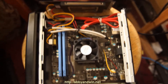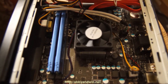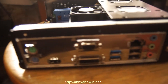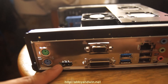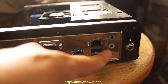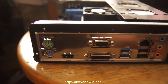It's a SATA 2 drive — not one of the faster ones — but its main purpose is to run an HTPC, so I don't need the fastest or largest. The Pico PSU is, I believe, an 80 or 85 watt unit. On the back we've got the ever-popular PS/2 connection, HDMI, VGA, DVI, two USB 3.0s, two USB 2.0s, Gigabit Ethernet, and a sound card.